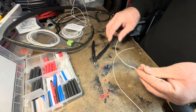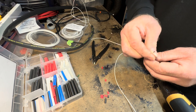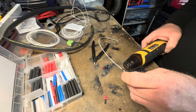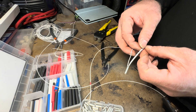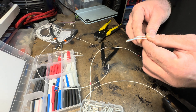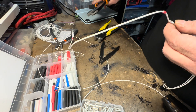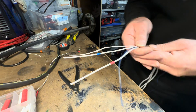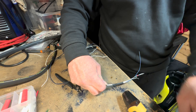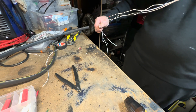Just making these power wires for the sensors: a 5-volt live, a 5-volt reference, and a signal ground. Oil pressure and oil temp share the same 5-volt, and then fuel pressure as well. Okay, these are the four channel wires — I'll colour code them again. Channel loom done for the four sensors.